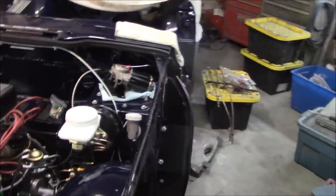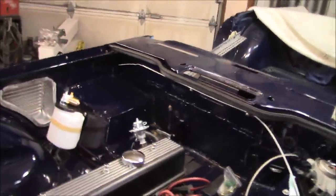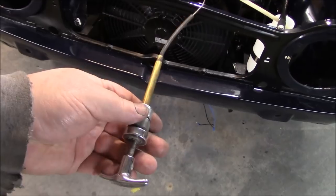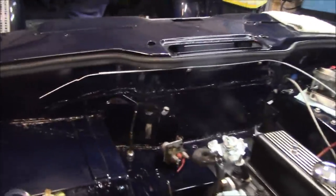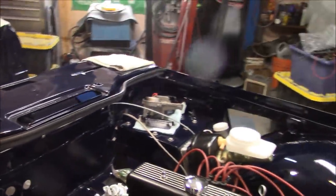That is the way the cable is run — we have it affixed to the bulkhead and we'll hook it up to the catch later. I'm just about to do the safety release. I've got a grommet in the hole I drilled, and we'll stick this emergency bonnet release through there, fasten it on, and get ready to put the catch on. That emergency cable is now installed — I forgot that it pushes up and bolts there, so no grommet needed.